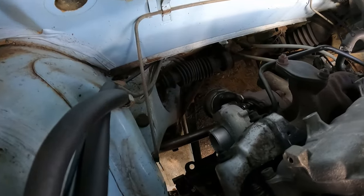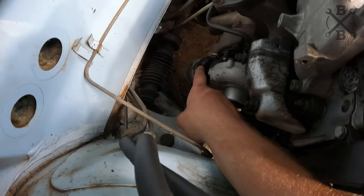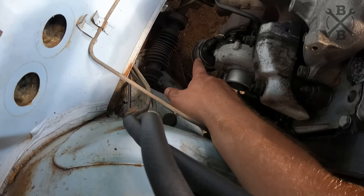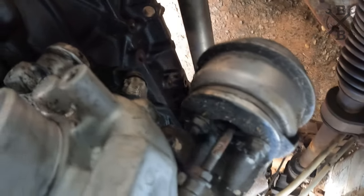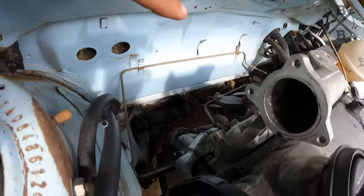All right, so on the cold side of the turbo there, or the cool side, first thing we need to take loose is these two 10 millimeter bolts right here, which is actually going to drop our VNT actuator, the little vacuum pod right there. The reason being is right there, that won't actually come past that. So first we'll go to pop it loose. There's a C-clip right up top there. We'll probably also have to pop off and we'll get that out of there.